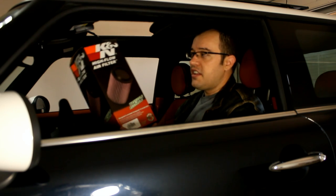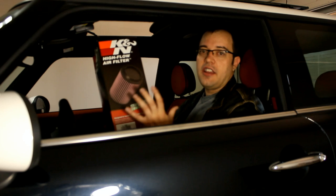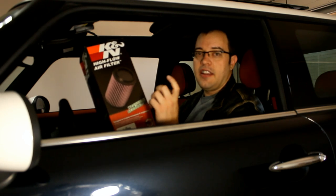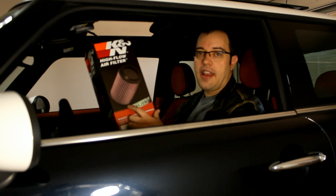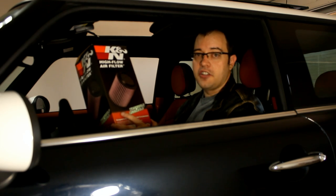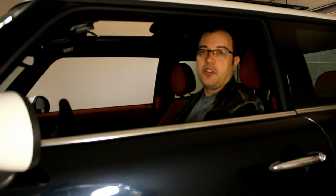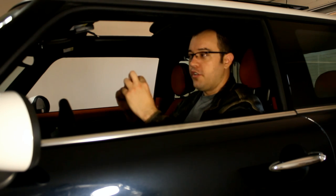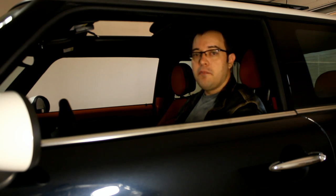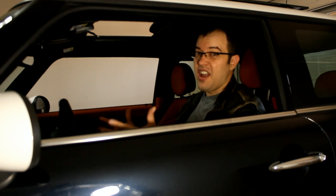This was $69, and the nice thing about this one is that it is the exact size where all you have to do to mount it is take the top off of your existing stock air intake, get a 90-degree angle bend, and stick this in there. It will just sit in there nicely, won't rattle, and you'll get a fair amount of air — especially if you have removed the plug from the scoop on your Mini Cooper. That's the second upgrade: delete the stopper that is in your scoop. It's supposed to be for aerodynamics and doesn't let any air in, but at most speeds your Mini Cooper is going to be more responsive with the cold air coming in through that gap.